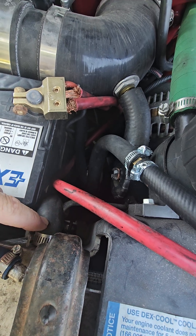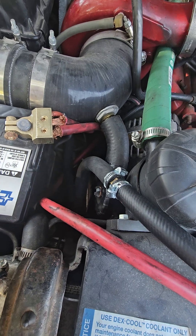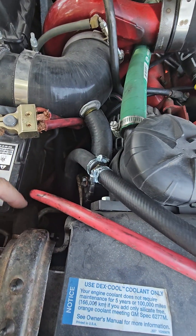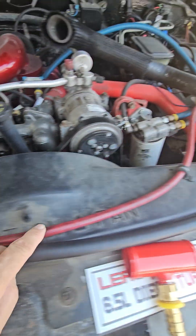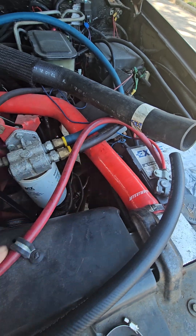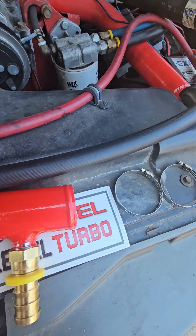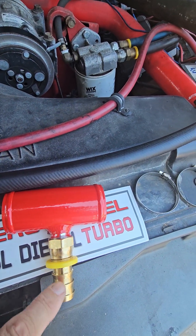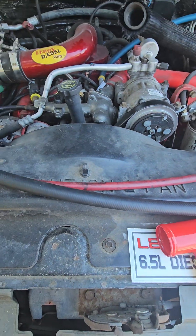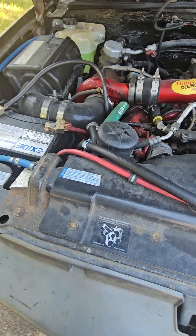This mock-up hose is actually the hose on the truck — the upper radiator return from your heater core. Instead of returning here, we're going to return all the way over to the suction side of the radiator system with that fitting. It's a push-lock — just cut the hose to length, push it on, and you're done. Pretty quick installation.